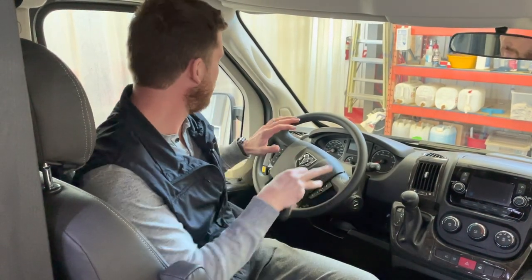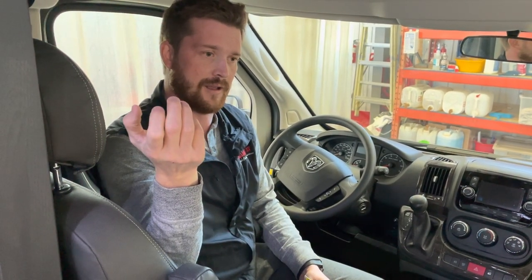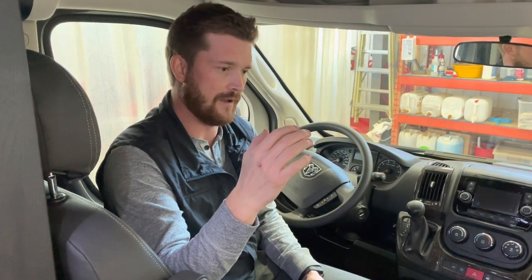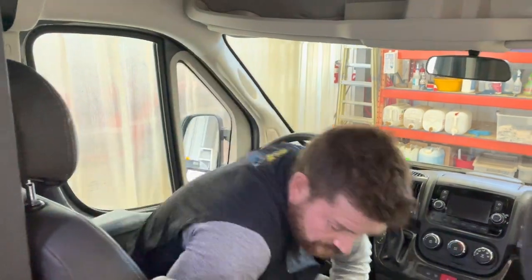Once you've done that, you've engaged the volt start system, and if you're leaving your air conditioning running or something like that, and it senses that you've depleted your lithium to a critical level, it will automatically start the vehicle and run for about 15 minutes. That'll bring the lithium up a good amount, and it'll do that up to 5 times before the volt start disengages. For now, I'm going to leave that switched off.